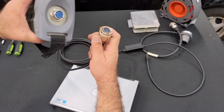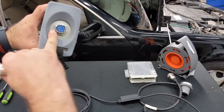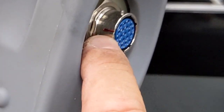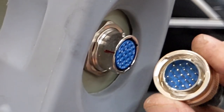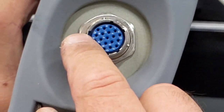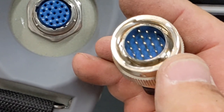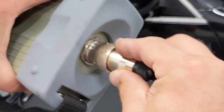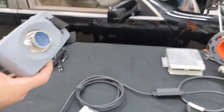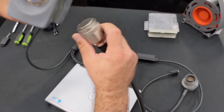Right, so you want to connect the small connector to the small connector on the Mercedes tool. It has a small red mark, which is located right there. We need to make sure we are connecting it properly. A lot of people, when they're trying to connect it, either break the connectors on the inside, or they just don't know how to connect it. So watch out for that. It's a small detail, but it's really helpful.